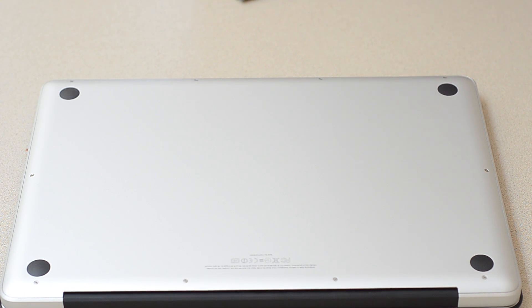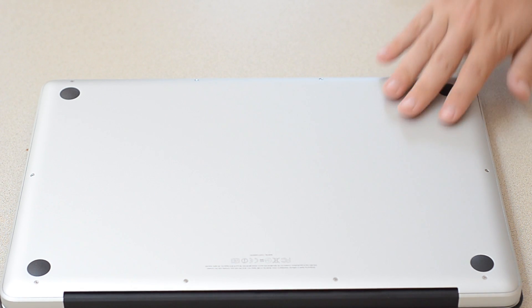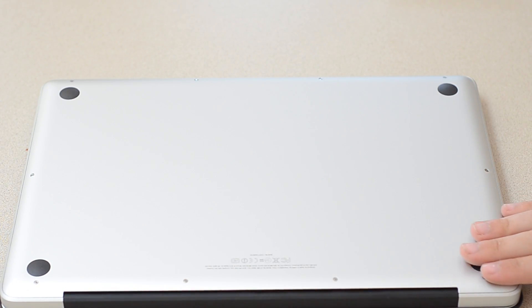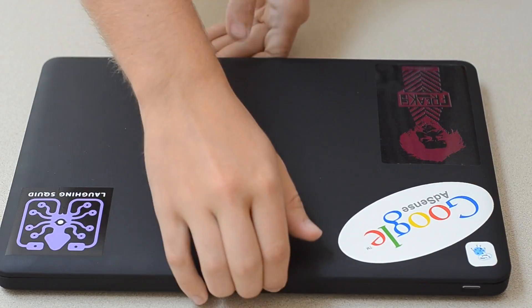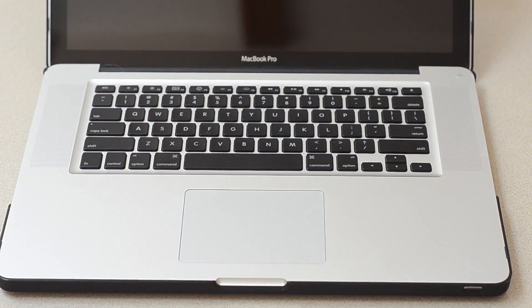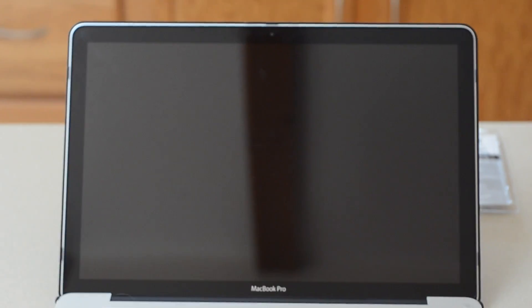What the next step we're going to do here is test the RAM to make sure it works correctly, and after that you're free to enjoy all eight gigabytes. A lot of people think that a faster processor is always better, and it is, but when you're at a quad core and your Mac is still slowing down during certain things — like huge programs, or I usually have 10 or 12 programs open at once — it's not the processor that's the issue, it's the RAM. I'll just snap it right back on and we have the final thing. So we're going to open it up, turn it on. It'll probably take a lot longer than usual, mostly because it needs to re-cache everything that it's had cached before.